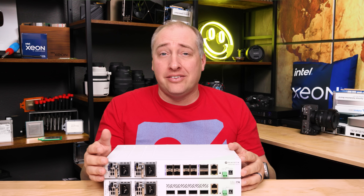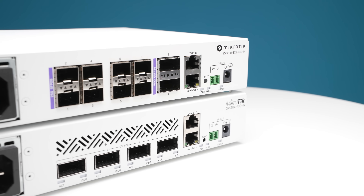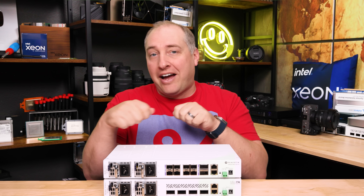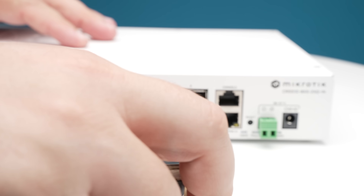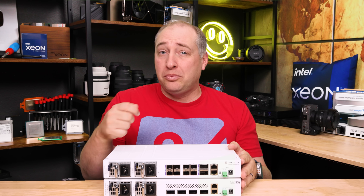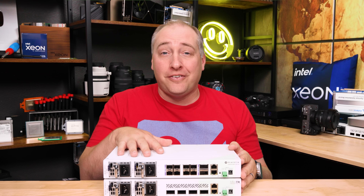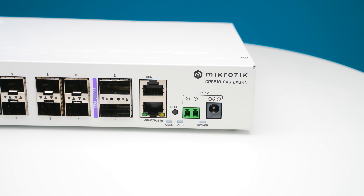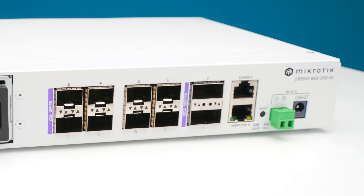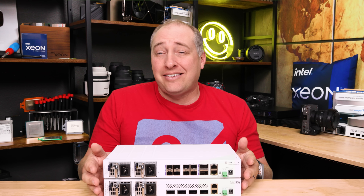On the other hand, a lot of folks have longer distances that breakout cables really can't deal with. One thing you could do is put a 100 gig optic with four 25 gig send and receive channels into the CRS504's QSFP and use an optical breakout box. The other option is just get the higher-end switch, put a $20 optic in, and you're ready to go. Maybe the reason we didn't review this switch earlier is because with the CRS504 we just use breakout cables. But I totally get why somebody would spend an extra $150 and just say, look — I want to be able to plug in whatever optics I want: longer range, short range, single mode, multi-mode, whatever kind of fiber. You can get SFP28 optics super easily and mix and match however you want. For $150 to have that flexibility, I don't think that's a crazy premium at all.